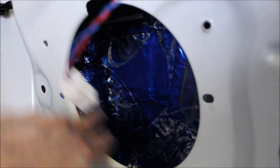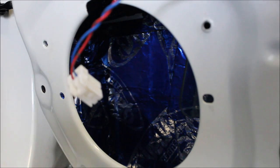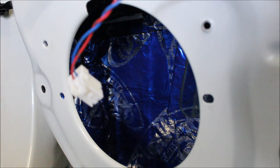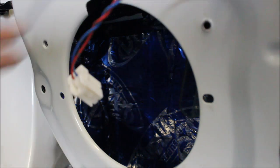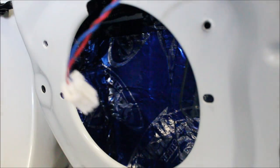For the first layer, you're going to get in there and cover as much of the area as you can inside the door. When you're done, it just looks like there's sound deadening everywhere. What you want to keep in mind is you don't want to get too heavy down low. Space it out and go with all the factory lines of the metal, because water drips down and you don't want to block anything that prevents water from escaping the door. Layer as much as you can so you don't get that tinny sound anymore — it just has a thud.